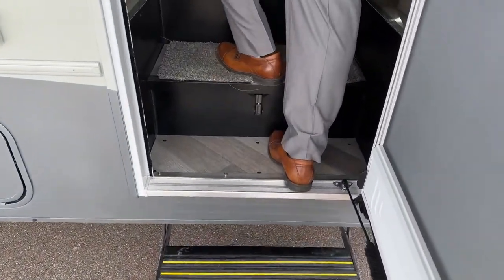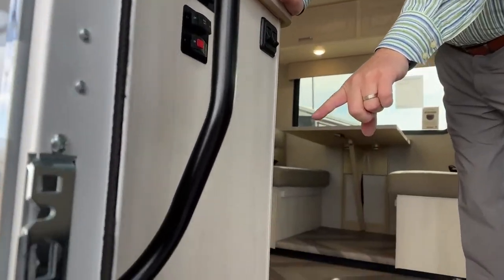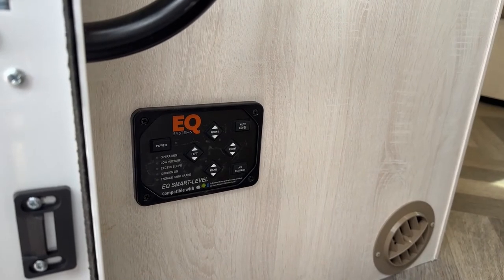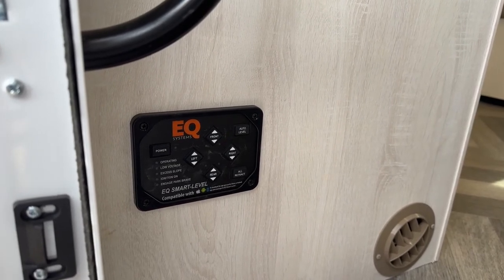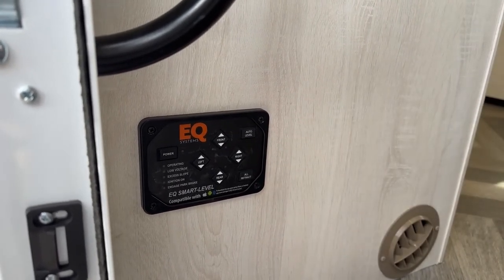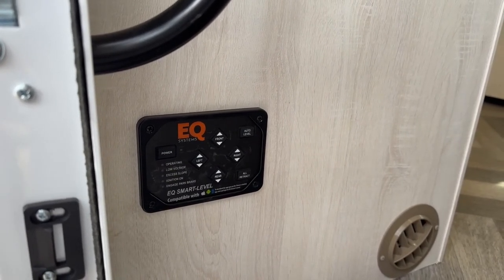There's a little outside light here — there are the controls for it. If you come inside here, you've got your automatic leveling. That's a big deal for a lot of campers; if you don't have it, you'll wish that you did. If you happen to have your jacks down and you turn on your engine, it'll beep so loud to get your attention. You get back here, press all retract — your engine has to be on and your parking brake has to be set — and that will allow you to pull the leveling jacks up. Once the beeper goes off, you're good to travel.